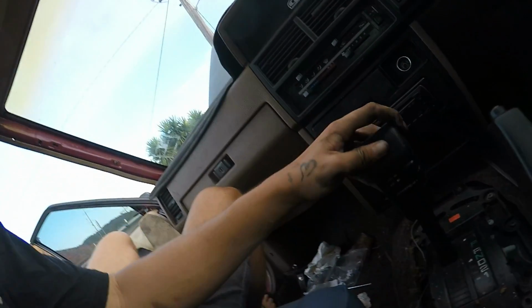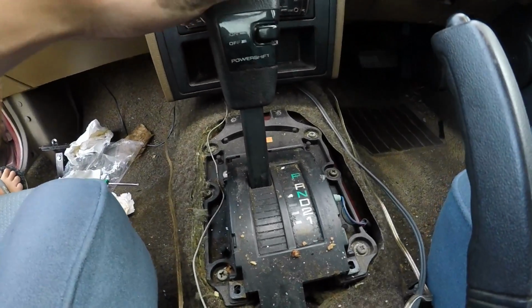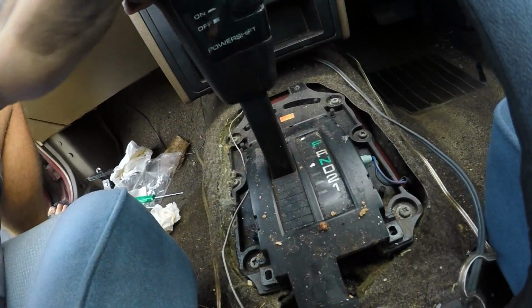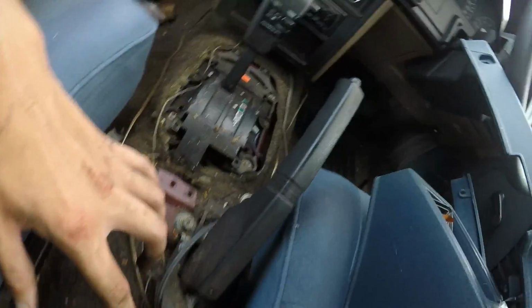Oh fuck. I disconnected the gear shifter. Probably should have put it in neutral first. So we just need to work out what the linkage does. So basically it's in park, gets click down 1, click down 2 is neutral. Do that underneath manually. Taken this off, disconnected the battery, undone the starter motor wires.